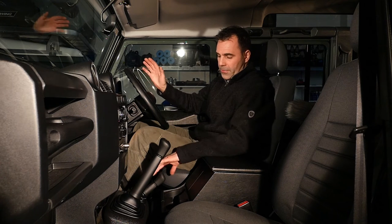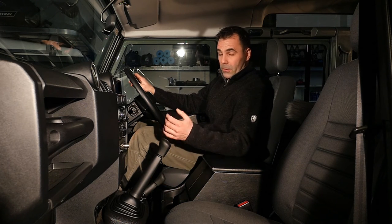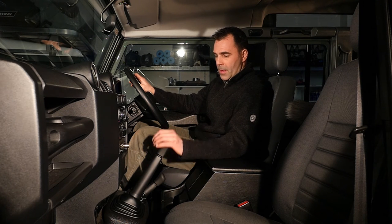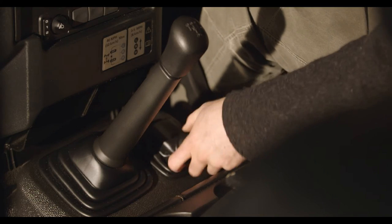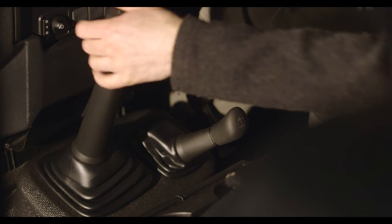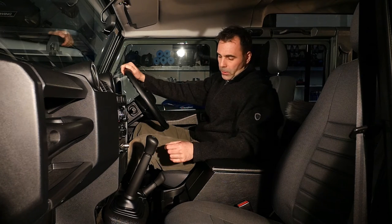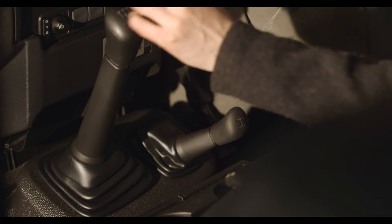Drive around on a loose surface with it off, with it on. But it's critical to turn it off when you get back onto a hard surface, such as a road. Again, stop the car, switch it off. Normally the warning light will still be on. Go into reverse and simply drive backwards a few meters. The transmission will unwind, as it's called, the warning light will go off, and you can be on your way.